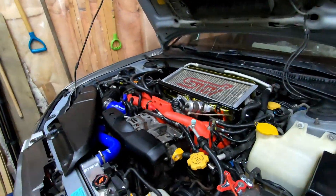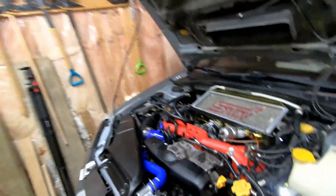Welcome back to the channel. Last episode we managed to get the EJ25 started and all buttoned back up together, looking fantastic. I started and realized I still hadn't bolted the downpipe on from the last time when I did the Perrin shifter bushings — and the reason why is because I didn't put one of these in. This is a rear shifter bushing from Perrin, and I think that's what's going to take up the rest of the slop in this shifter. It's a Kartboy already so it should be fairly precise.